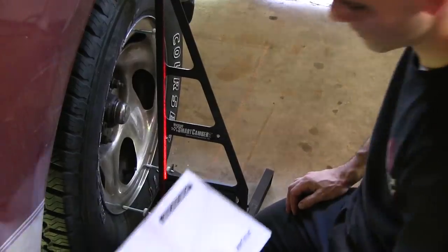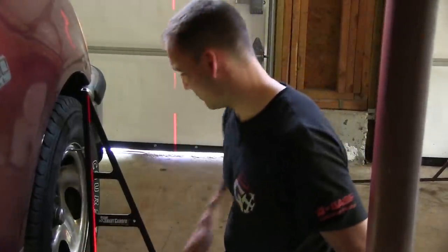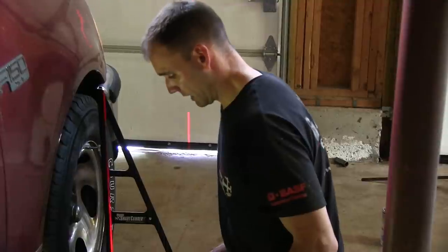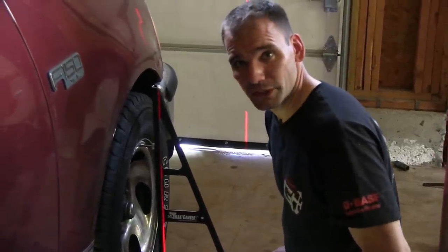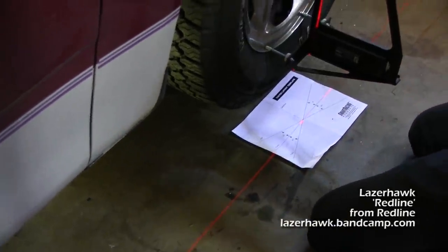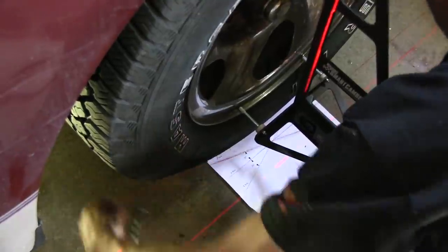All right. The problem that we're having seems to be, how do I know what 20 degrees is? We took the plate out. I've got my carpenter level down the side here, giving me a line parallel to the truck. And I'm going to make marks on the floor so we have reference marks. I'm going to mark out 20 degrees both ways, and then we'll put the plates back under it and see how close we can get. And we need our two 20 degree lines. Nice.